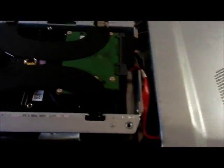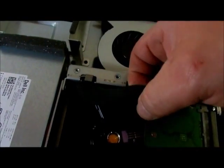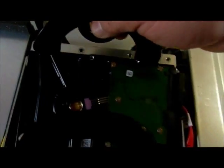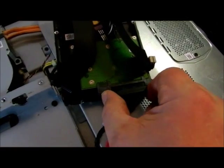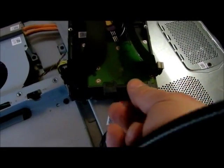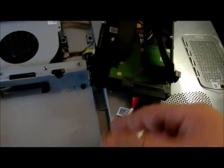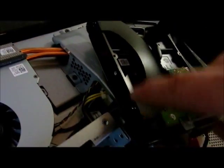Now we've got to get the hard drive out — it should just slide out or pop out. I'm going to lift it up. There's a handle here, just lift it up, and then straight out and move it aside. I'm doing all this with one hand, so eventually the cable will come off — I'll probably need two hands for that. There's a little handle right here to do it. It looks like a screw on each side to take it off — take out the hard drive.